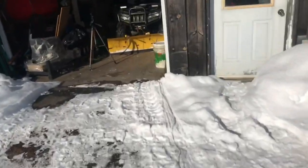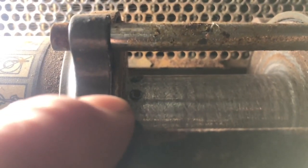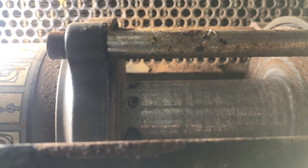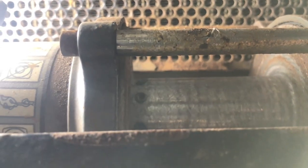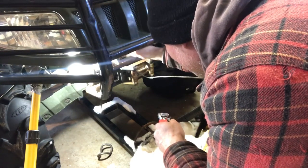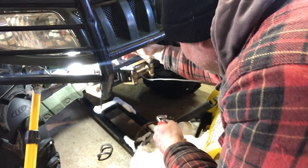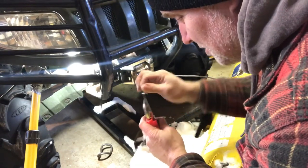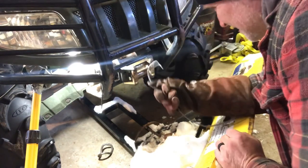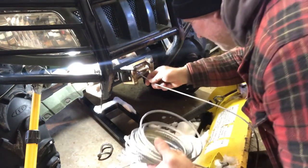After you pull the cable all the way out, right at the end there's a little Allen screw you've got to loosen off, then you pull the cable out, fish the new cable in, tighten it back up, and then start winding it in. My winch has a three-millimeter Allen screw. I got in there and it was actually loose — I don't know if it just came loose over time. Give it a tug and it'll come right out. Now you have to fish the new one through.